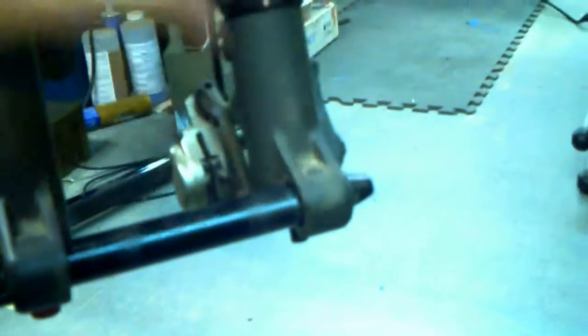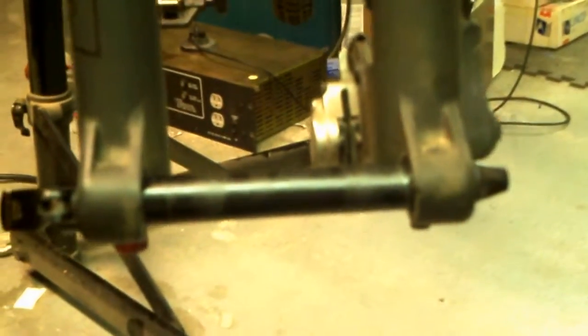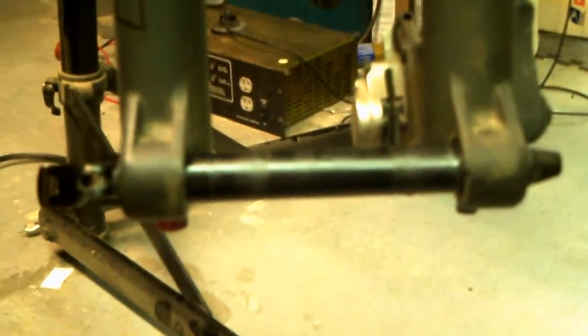and bonds. When the wheel's in, these two fork legs clamp into one another, and you can see there's a little ridge right there, right on the inside. That ridge bites on to this hub, and what happens is it squashes the two fork legs onto the hub, and that's where the rigidity comes from, and that's really what you don't get from the other type. It's not so much that the axle is big for the reason of bending. It's more to keep the front end really, really stable and locked together.